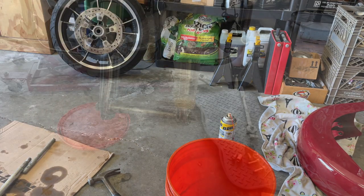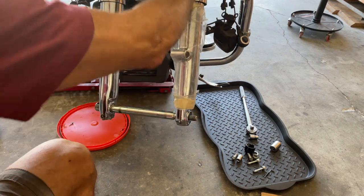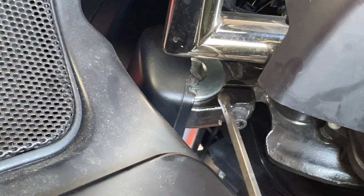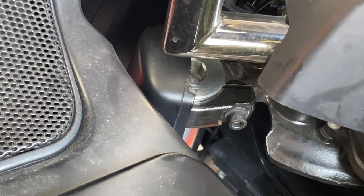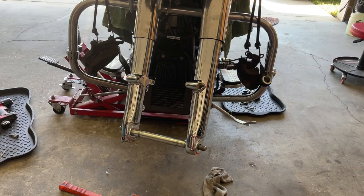Now by feeding the axle through here, it squares everything up and I can tighten up this quarter inch. The utmost important thing is that the reveal is the same on both sides — that's pretty much how I index this front. Now that we made sure everything is indexed right, we got these last two pinch bolts. Be conscious of how tight they were when you took it apart. I'm going to go through all the torque specs and I'll have it written in the description. Any questions, just ask. Now I'm going to throw the fender on, then the wheel, and get this thing done.